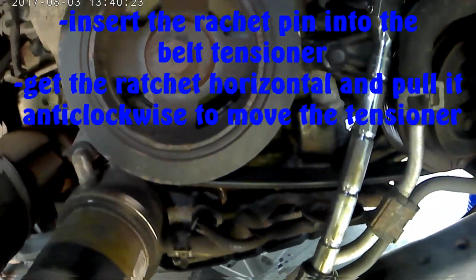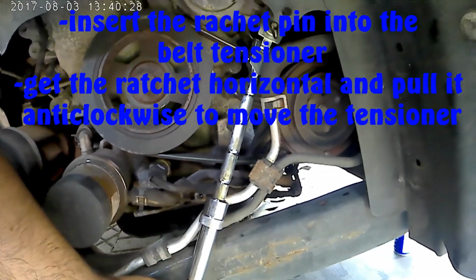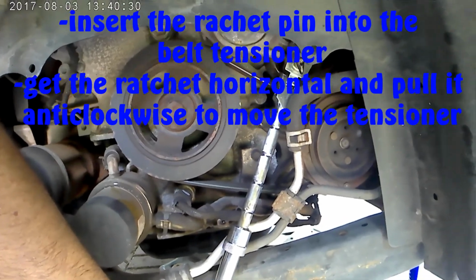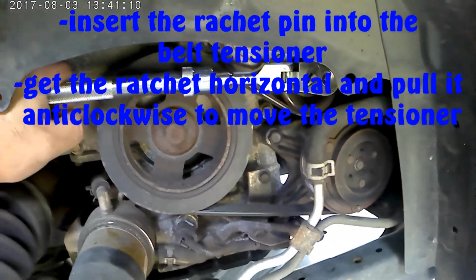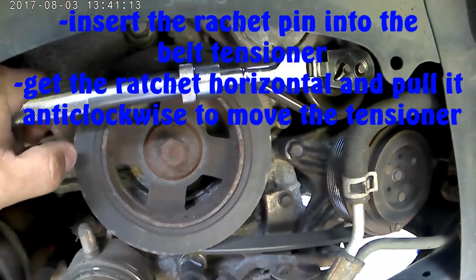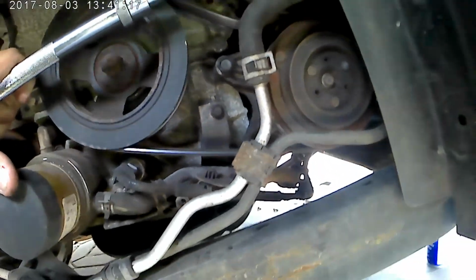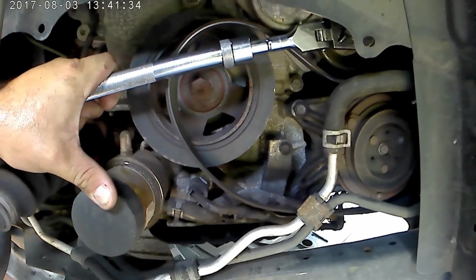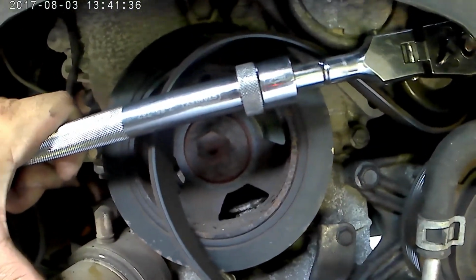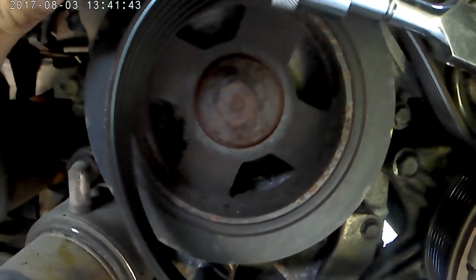And obviously I'm doing this with one hand, so I'm gonna need the old one, so I'm gonna show you when the belt is out. So a quick update, the best position to get the ratcheting in is this. So you push it down, have the clearance to get the belt out. So as you can see in that position, the belt is easy coming off. Okay, you see, and then you let go the ratchet,